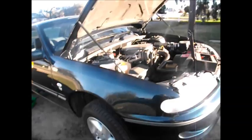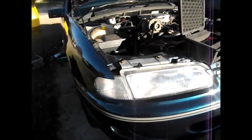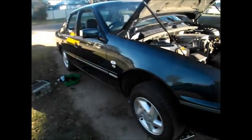The fluid I'm putting in is mineral-based — this transmission was originally designed for it anyway. The fluid does say it's compatible for this car. Synthetic fluid is probably technically better and should have a longer service life, but I change things so regularly it just doesn't matter. It's like synthetic engine oil — I'm changing it every 7,000 k's at the latest, so more frequent changes just keeps it cleaner in there, especially if you drive the car hard.